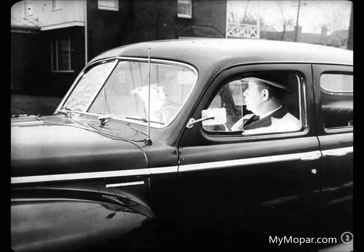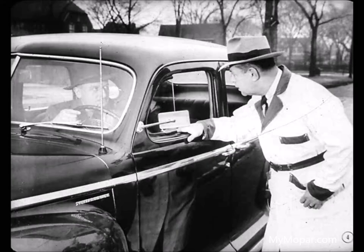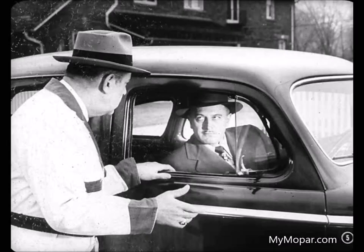Yes, Mr. Clayton, that's a brake noise, all right. Now, suppose you drive the car for a while. I'll get out and stand on the curb. Then, as you stop the car in front of me, I can tell whether the noise is coming from the front or rear brakes. All right, Bill. That's fine, Mr. Clayton. It sounds like a front brake to me.